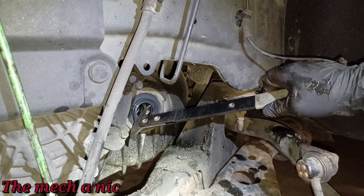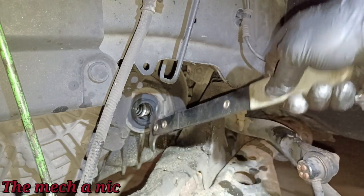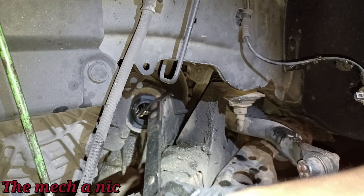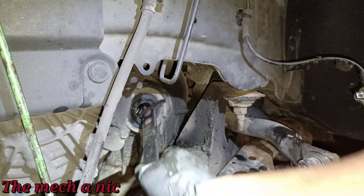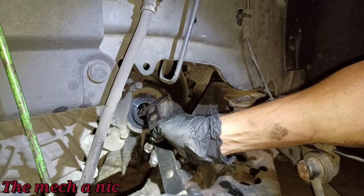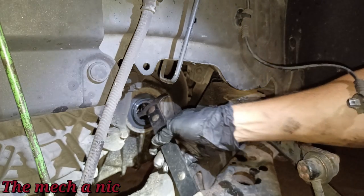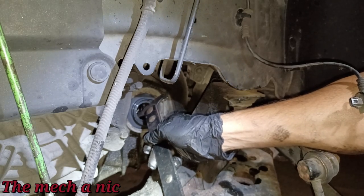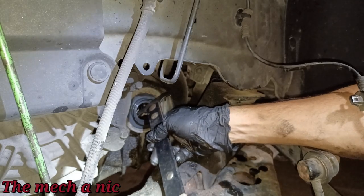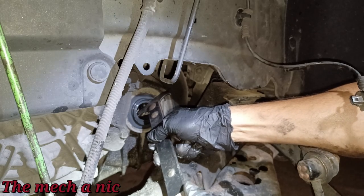The downside to this tool is the angle — I need to get more angle inside but I'm already hitting the frame rail. Trying from down below. You've got to make sure you go in at a right angle — you do not want to scratch the sealing surface. I like to get as little a bite on the seal as possible. I can already hear metal if I go in too deep — if you force it out that way you could potentially scratch the sealing surface.